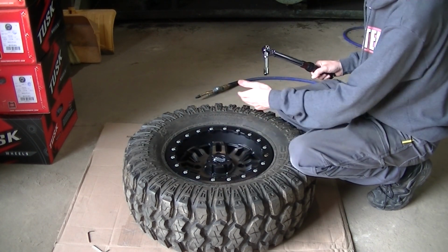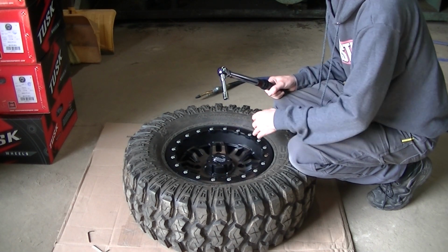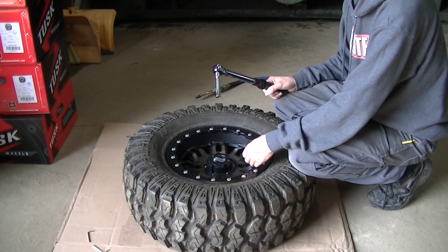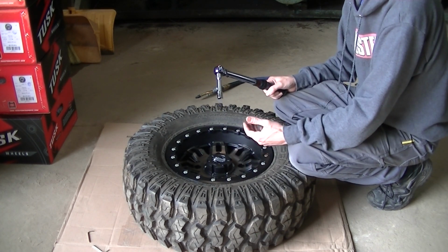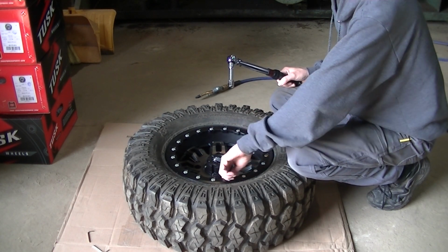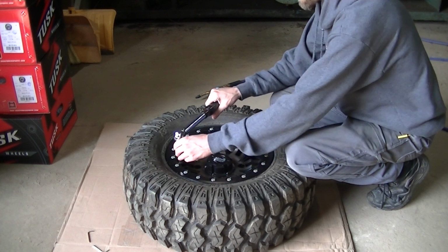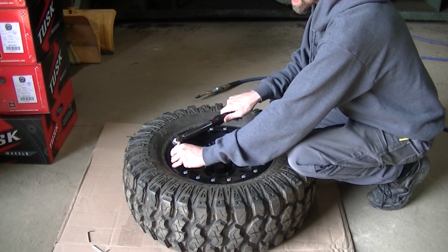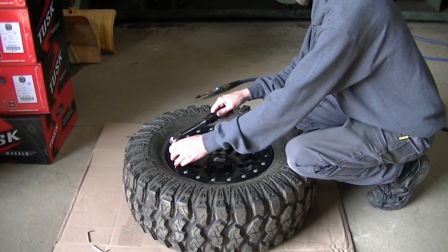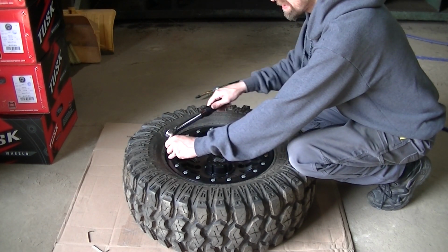Okay, so you're going to go around and around this thing, and you're going to hit your torque on the bolts, and then you go around, and you'll notice that your bolt is still turning before it's torqued. So you got to keep going around and around, and the reason that's happening is because this is compressing the rubber, and every time you tighten one to the 10 foot-pounds, the ones around it are loose again. And you just got to keep going around and around